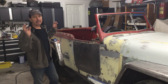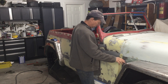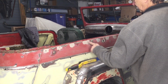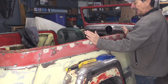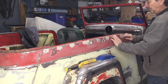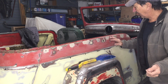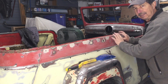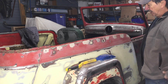I want to get all the bodywork done and get it all into primer. I've got everything fitted — this fender is just a little bit high so I want to adjust that down just a hair. This had holes drilled all along this edge for the convertible top snaps, and a side window that snapped on here and on the door. I welded over all of those holes — two reasons: I don't want them, and I don't know if the snaps will be in the same place. So to guarantee I get this exactly the way I want, I'm filling in all those holes and then sanding.